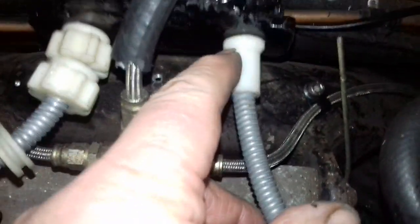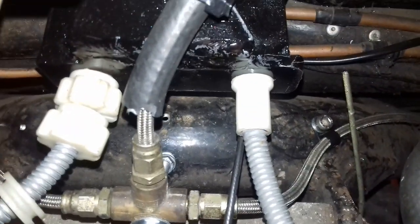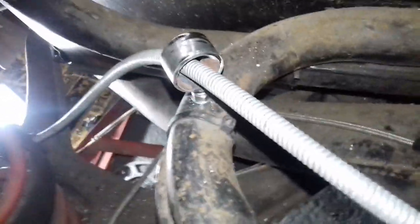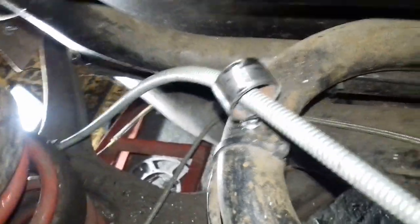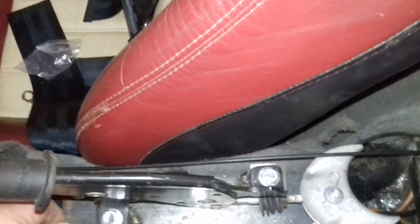I've got to make a little clamp for this cable — it's supposed to have a circle at the other end but there's not going to be enough room, so I'll have to be quite inventive. That's the adjuster on this side. There's another wire just to keep the handbrake cable in place — I'll probably put a piece of rubber in there. The handbrake lever is all in. I'll tidy it all up later, but once the carpet goes over it you won't see anything anyway.